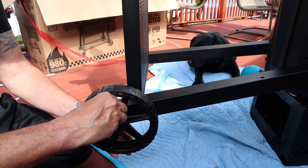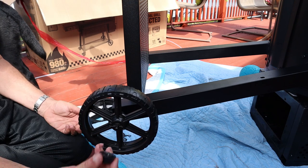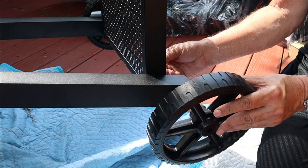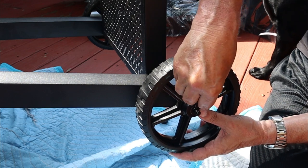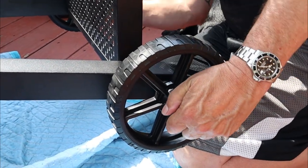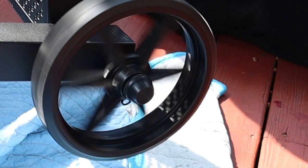There you go — as Molly does nothing. There's your locking lug: a washer, cotter pin, and then your locking lug. Of note, you want the smooth side of the wheel facing out and the honeycomb side facing in. Get those lockers nice and tight and you're all good to go.